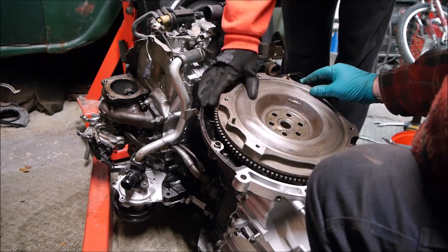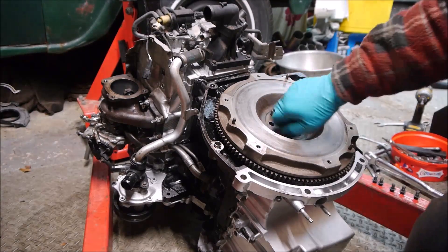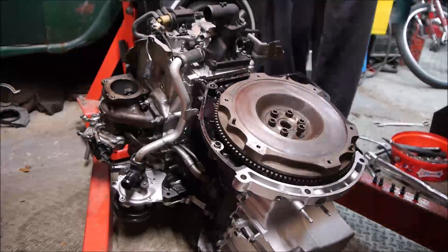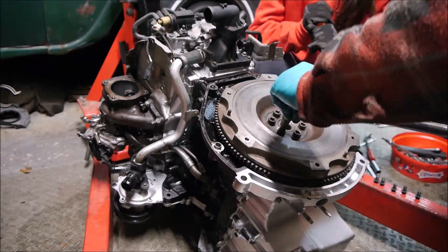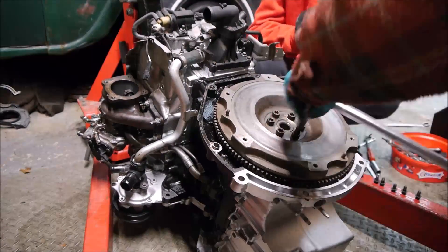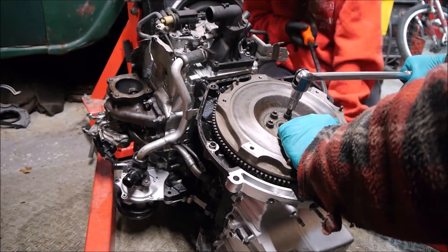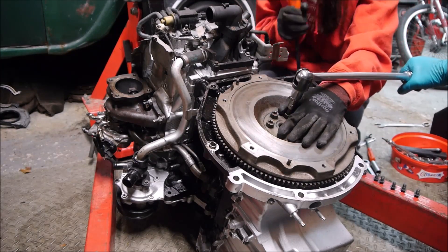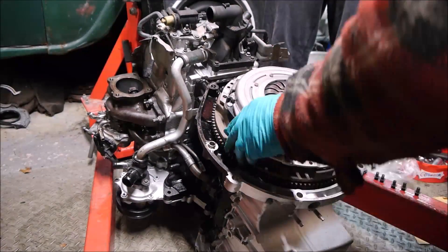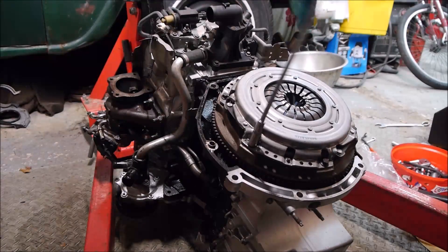A little bit more of a sped-up montage here just nipping up this seal on the crank, which is just behind the clutch and flywheel. Just nip these up evenly - about 10 Newton meters. Then the flywheel goes back on. Even though it's got six bolts and looks evenly spaced, they're actually slightly offset so it'll only go on one way around. Then you put these torque-drive screws in - it's a bit of a nightmare with a combination of torquing angles and not losing where you're up to in the process. When you've done your final torque, put a bit of a mark on them so you know you've given them the full torque.